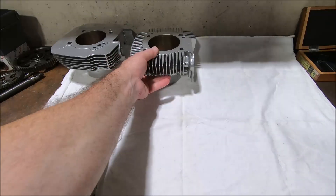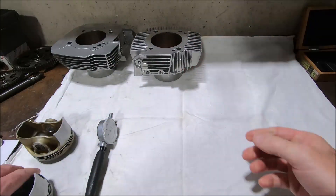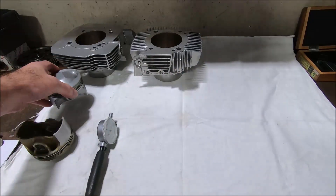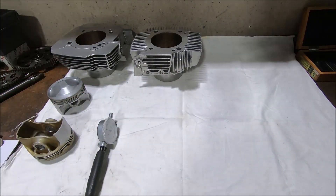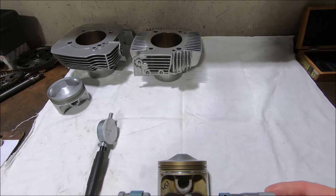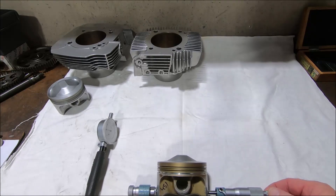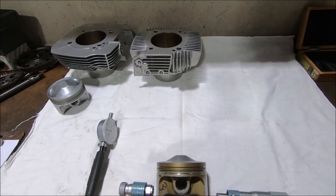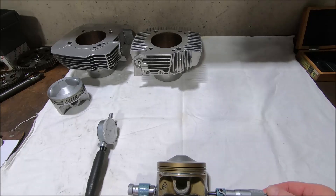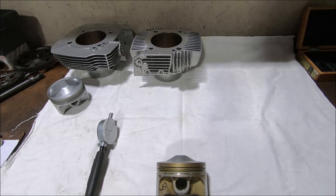That is an A cylinder, as you can see there, and our B piston — so that's fine. Let's see if the other one has got too much clearance. The matched pair might be the problem. It's definitely on the small side. It looks like it's got hardly any wear on the skirt at all, but it definitely appears to be on the small side.